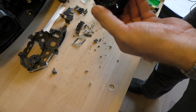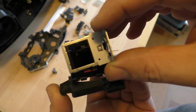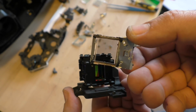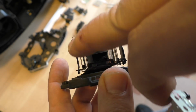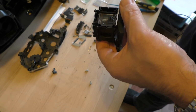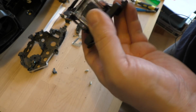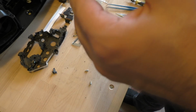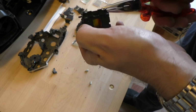Okay, there are the other polarizers in here. Is that true? Let me see that. It's now black. Yes. So that's the polarizer in front of the LCD, and here is the polarizer. You can see these little polarizer panels here, because the LCD always needs to be sandwiched between 2 polarizers. And when the LCD panel alters the light, you will see light, or not, depending on what the LCD panel does.